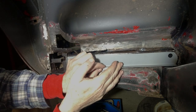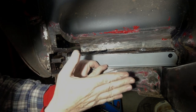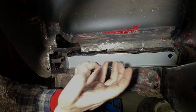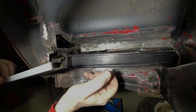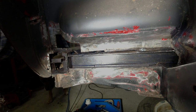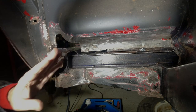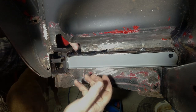On the previous video we talked about how to make and weld corners. I left this corner here because the condition of it was okay, and it would have made things more difficult — I would have had to cut out more of the cargo floor to create that corner if I hadn't. It's all about weighing up the situation before you go cutting. I'm a firm believer that there's no point going around the bus with a cutting disc just cutting off everything — number one, you're weakening the whole main structure. You take on one repair at a time, get that done, then move on to the next one.